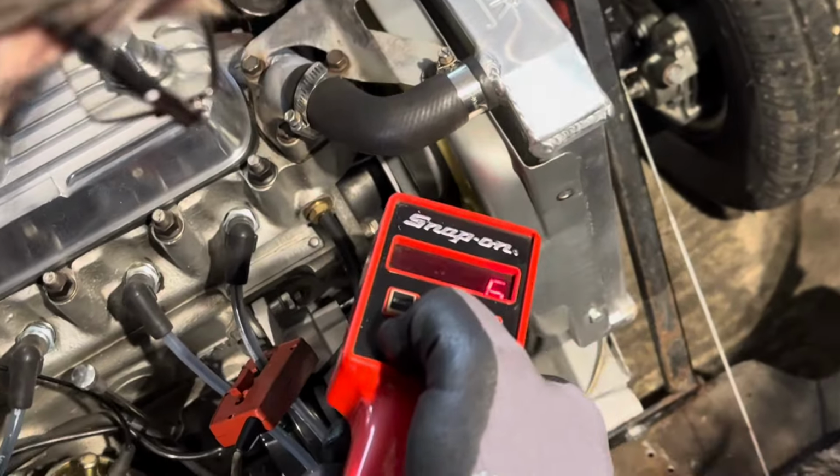Okay, so we finally got there in the end. Now this was a royal pain, to be precise. The carburetor, although it responded in every other respect to the fueling changes, had an accelerator pump effect that was on the extreme end. So I can put some very thick oil in it to try and get enough fuel enrichment on the acceleration. But we have a workable engine.